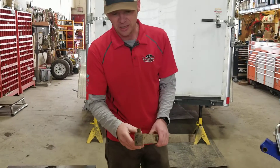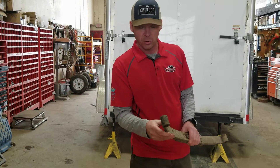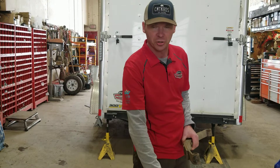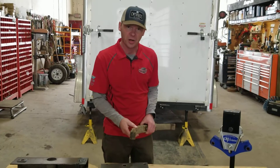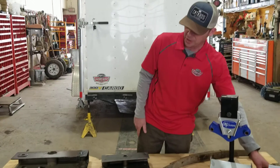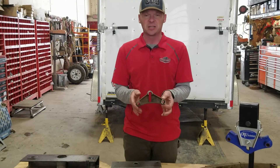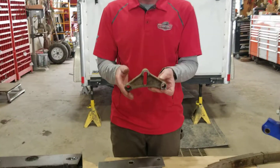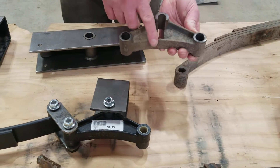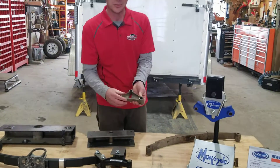This shows you some of the bushings that are in these leaf springs. We've got a nylon bushing, and they get worn out. So then your bolts are able to sit there and rock back and forth and get worn, and that's going to cause further damage into your hangers. Maybe your frame on your trailer can get cracked, because you don't want that much movement in your trailer. We had a customer that waited years before changing out their bushings, and this is some of the effects you can see. This is a brand new equalizer here — you can see the differences. There's an incredible amount of wear there, almost to the point where this was ready to fall right off.